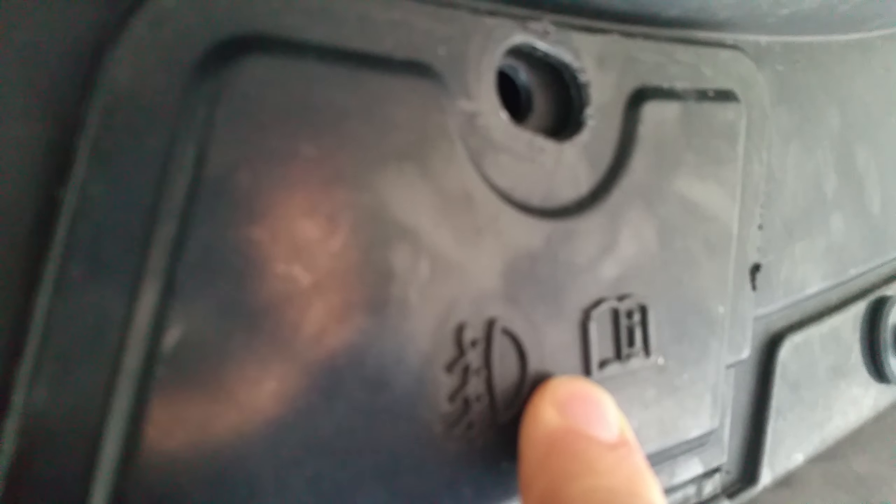That reveals the access door. Underneath you've got a cutout and a nice indicator telling you to check your owner's manual. Essentially there's a perforation showing where you have to cut to get access to the bulb — kind of messed up, and when you're done you just put the flap back over. It's pretty ridiculous but that's just the way it is. To cut this out I'm using a Dremel — it's going to be faster and neater. I'm going to cut from the bottom corner up and around, leaving the center portion for added waterproofness against the weather.